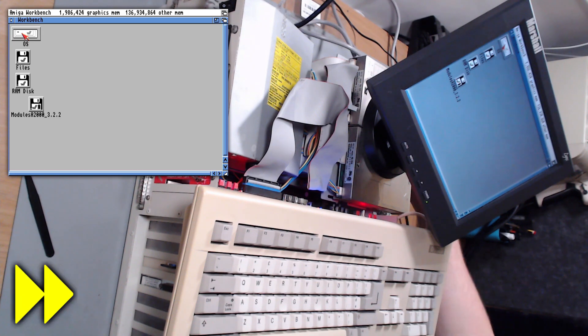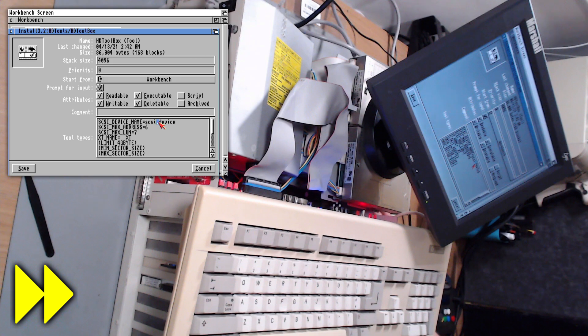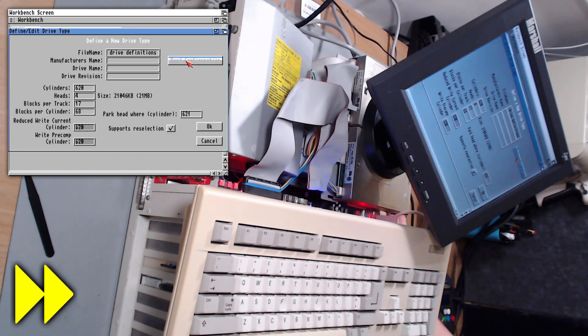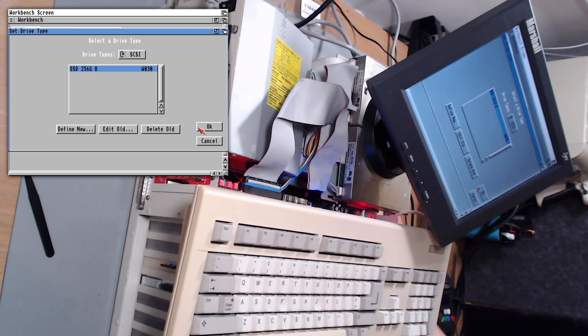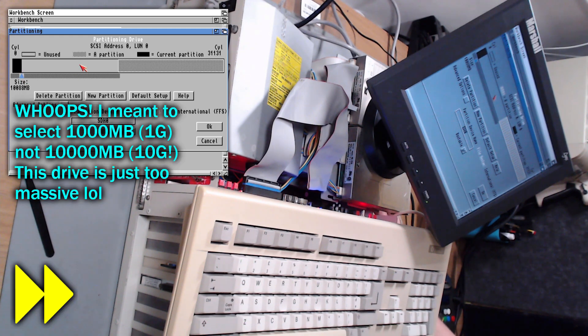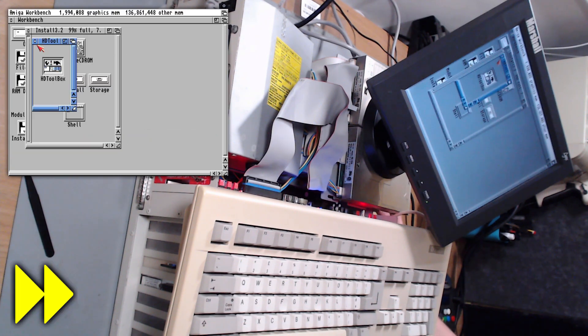To make that easier, I've written the installer ADF to a floppy disk as well. Like before, we need to configure it for the LIDE.device. Only this time when we go into it, it recognises the drive size properly. I'm going to make a small 1GB partition. A small partition is a good idea for the main system drive because of compatibility with some software. And I'll decide what to do with the rest of that space at a later time. Once saved, I'll reboot.